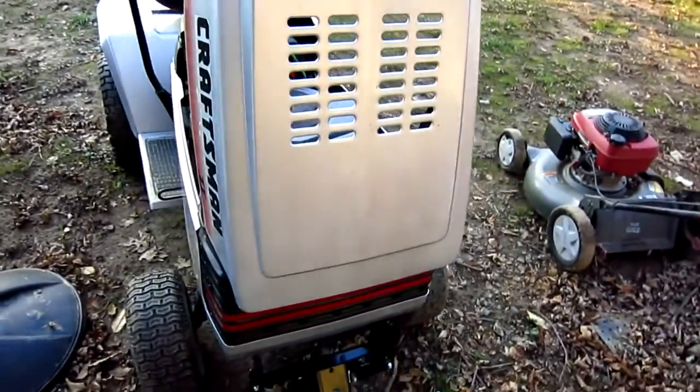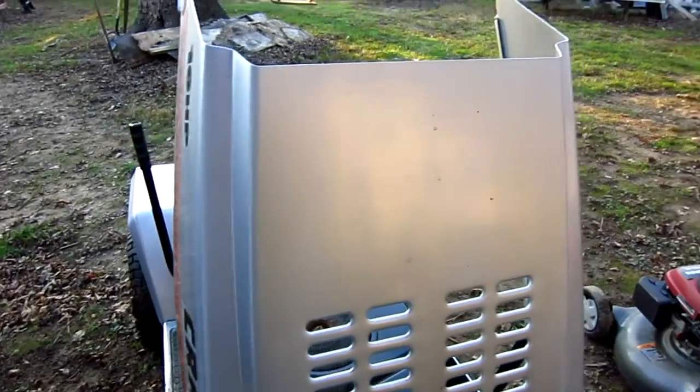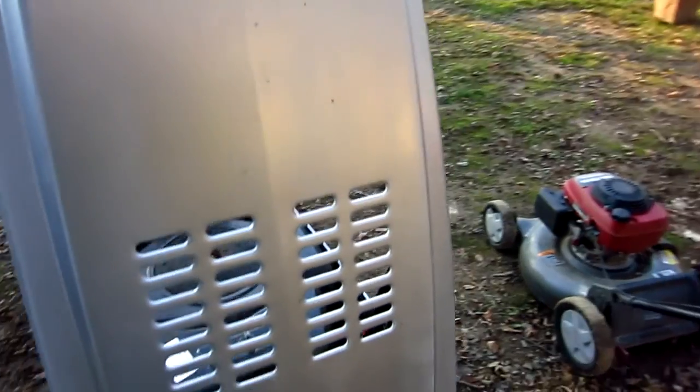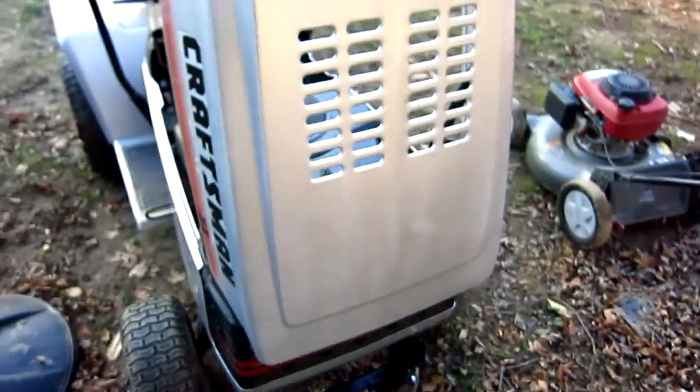And then I clear coated it, and what I did differently this time was, because spray paint likes to leave a lot of orange peel and such, and really rough paint, I sanded it down and compounded it, so you can see the reflection from this angle anyway. I haven't done it perfect.